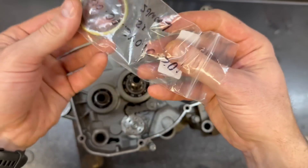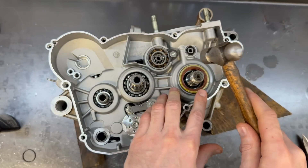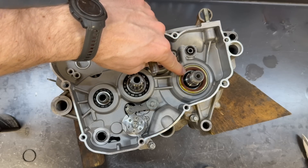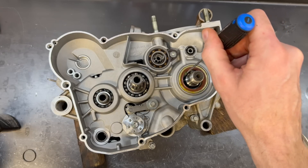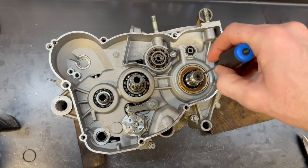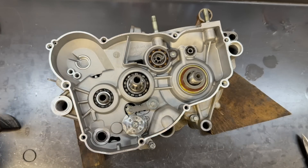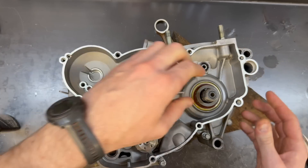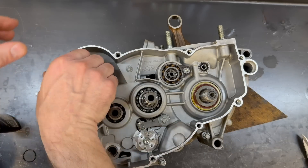I've got my OEM right-side crank seal here. I have good access to this, so I'm just going to tap it in. I have seen a couple of bottom-end failures because the crank seal is pushed in too far — it rubs on the bearing, creates excess heat, and takes out the bearing. Now, a little bit of grease on that lip. It's very easy to fold one of these lips in while you're doing this. What I do is kind of wiggle it back and forth and rotate it because I don't want to fold that lip in. You can see that lip is folded in — if I had just continued to keep yarding on it, it would have wrecked it. I'll just back off, spin it a little bit. Right side crank seal, done.